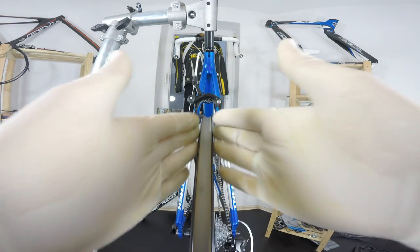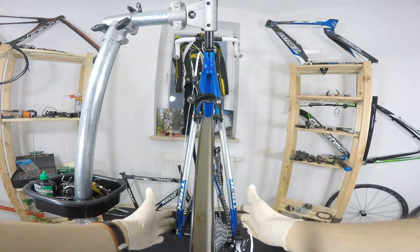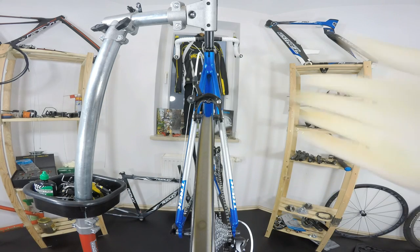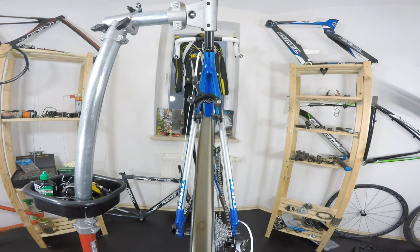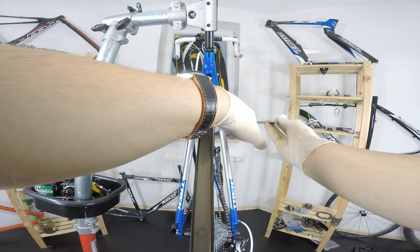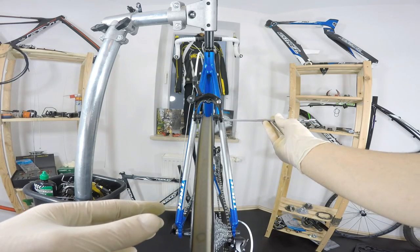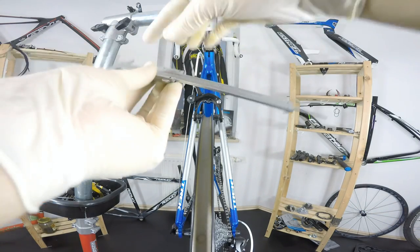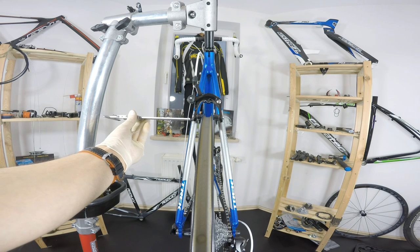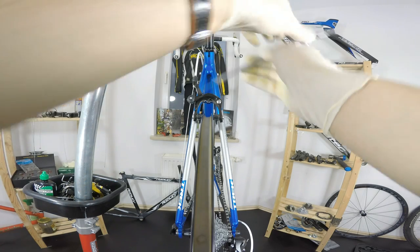And we actually have this problem on this bike, because when I just look at those chain stays, seat stays, I feel with my eye that it goes a little bit to the right. So the dish of the wheel is not made right. But to confirm that, I'm using the caliper. It's a super easy, non-scientific method. I'm just checking the distance between the seat stays and the rim. I don't really have to read how many millimeters it is. I'm just putting the caliper on the other side, and yes, it confirms that we do have a little bit of a difference.